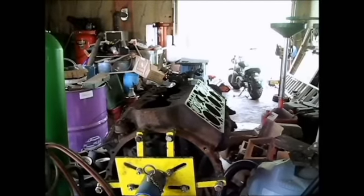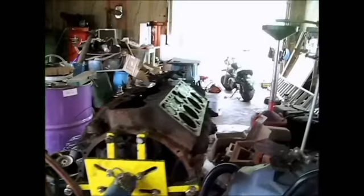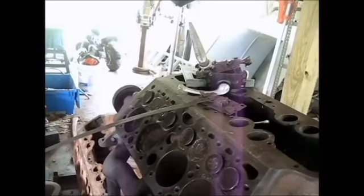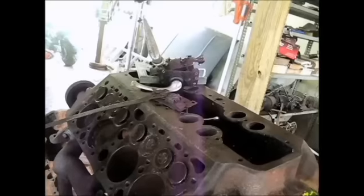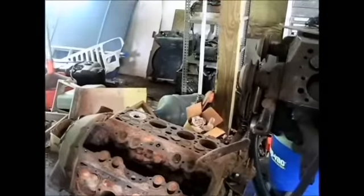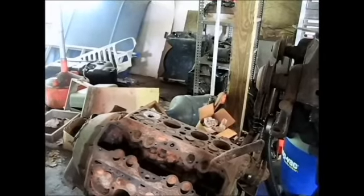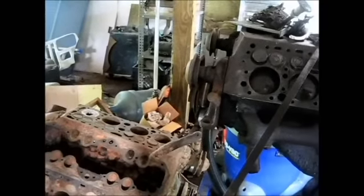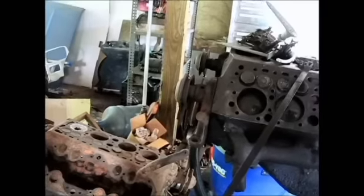And they ran carnival rides, and they ran a lot. Is this thing turning over yet? Nope. Oh, it looks good — you sure did a good job getting it all cleaned up and prettied up. The heads on that motor right there are usable. Both those other heads are broke — look at the pistons. If you flip that block upside down and look down in the water jacket on that front piston, she's busted right straight through the cylinder. Have you had the oil pan off this one yet? When I did have it off, it looked pretty good.